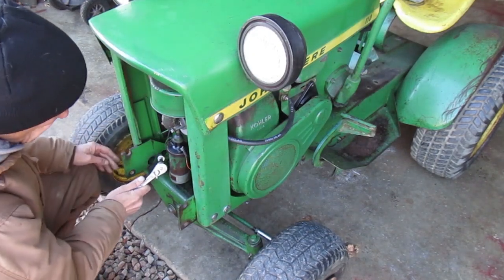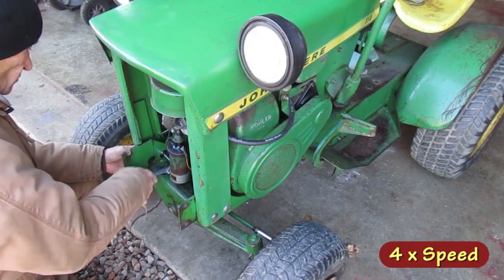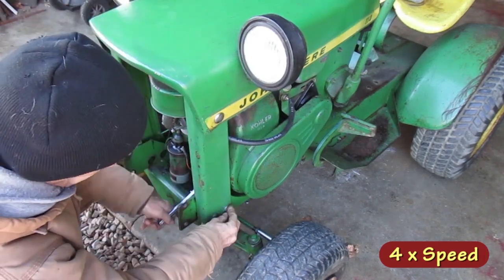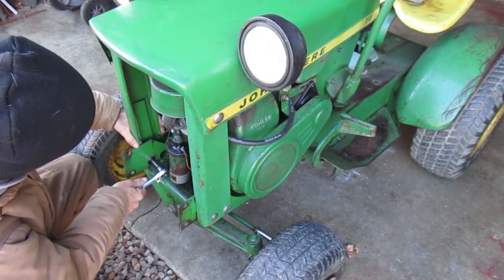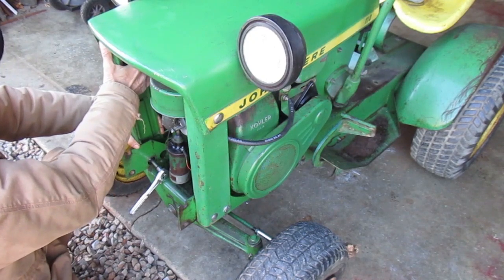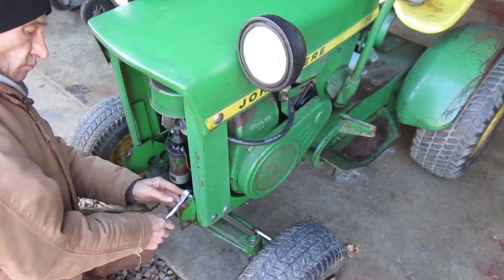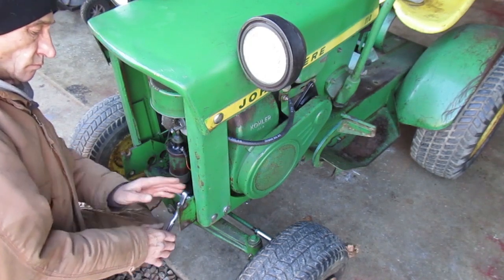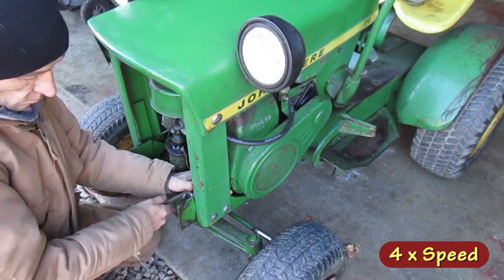First, I want to loosen the bolts in the back. They got to be loose enough the lock washer's loose too. I'll start with this side. Loosen it up slightly. And move the top forward about a half inch. On the other side, I'll move it forward until it's parallel with the first one. That moved it closer.